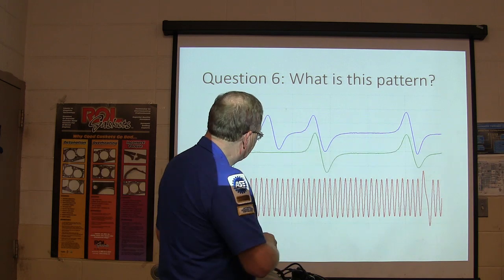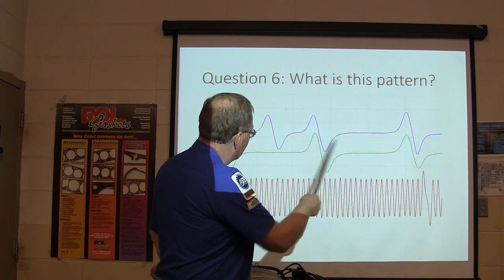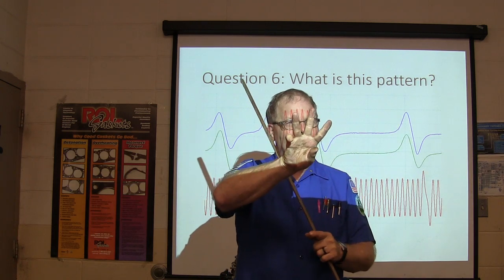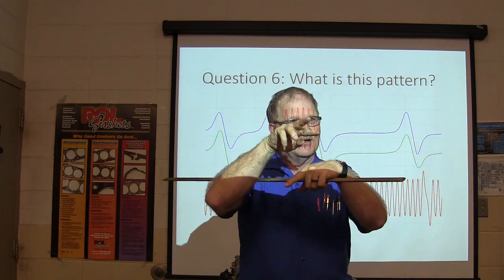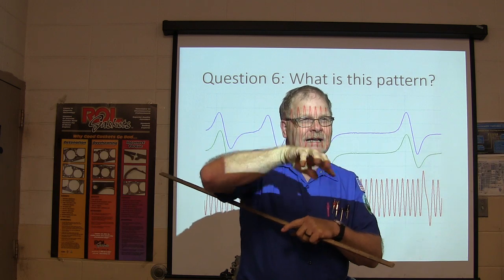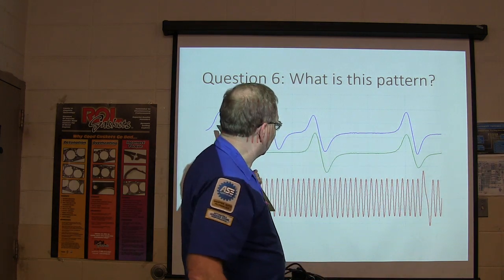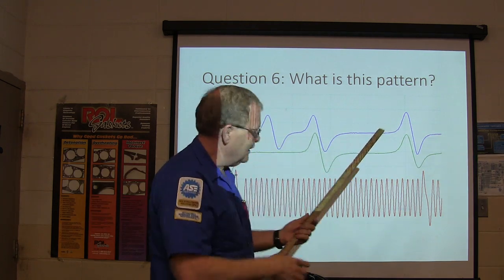Right? There you go. Now, these 2 cam shafts, they're supposed to line up. Have you ever seen those little cam phasers that got these funky little things sticking off of them? You know what I'm talking about? They got 3 sticking up and 1 sticking down. You've seen that, haven't you, Kayla? That's what's making these. They're sweeping past that little cam sensor.